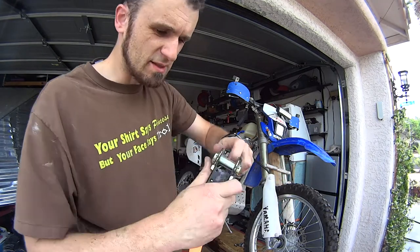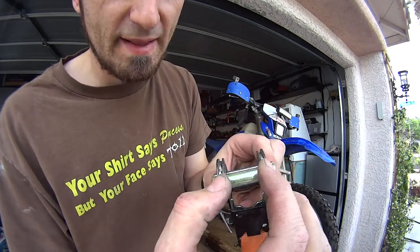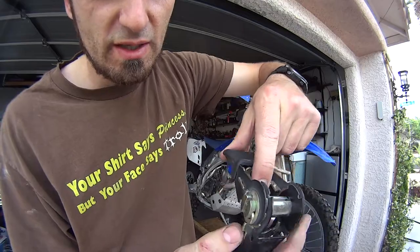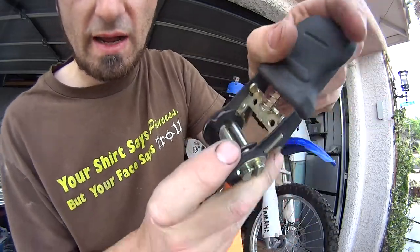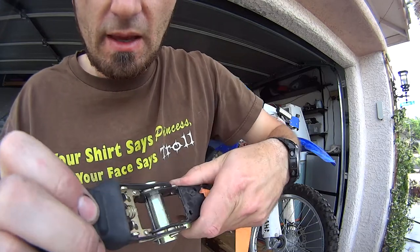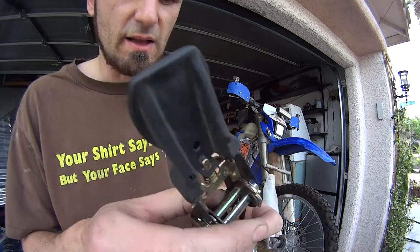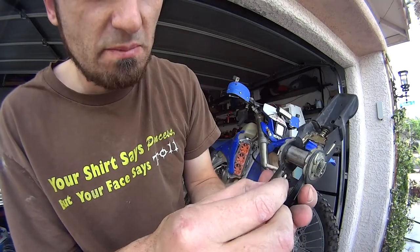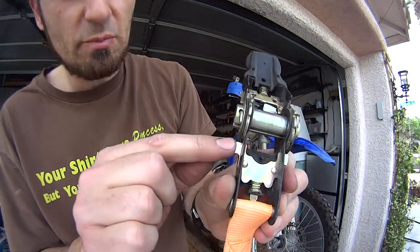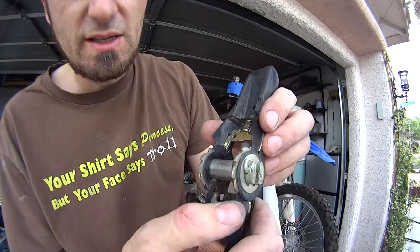So the part that has a tendency to fail is this mechanism over here. These little pieces usually bend in, so when you pull on this part, they were supposed to lock it in this place. You see there's a little lock that has to go in. That lock pushes this bottom part out that would allow you to release it. Sometimes when these little ears bend, they cannot push on this trigger anymore, so it will never release the tie.